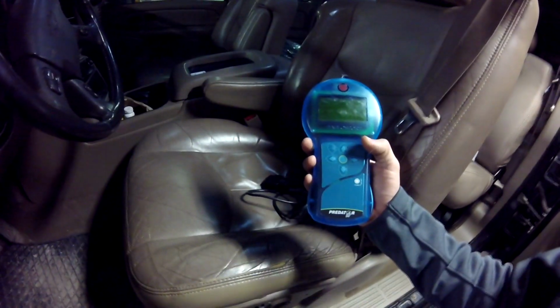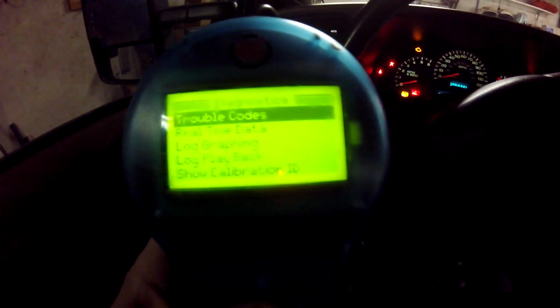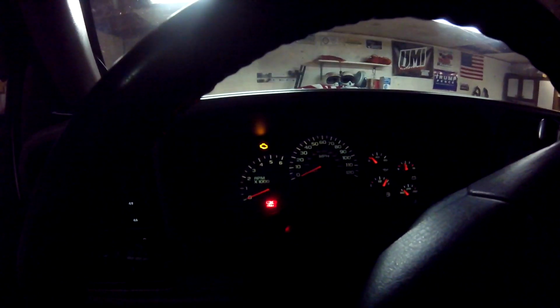Just to wrap this video up, one kind of cool thing is this truck came with an old ancient Diablo Sport Predator. We will clear the code. You're gonna have an engine light on no matter what when your key's on and the motor's off. So let's see here. We can go down to diagnostics, trouble codes, show trouble codes, see what we got going on. Any faults that were there are now cleared. So I'm going to unplug. Hey, it's gone. So all we should have left is the frickin' airbag.